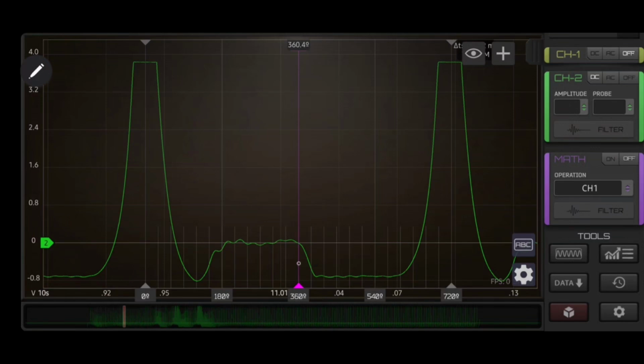Now see this right here, this is what I was talking about earlier with our top dead center mark. See how it's right here where this waveform starts to come crashing down? That's good. That's where we want that to be. And then we're somewhere around 20 degrees right here, because you want 30 degrees for a non-phased intake cam, 20 degrees for a phased intake cam. So we're about 20 degrees right there, which is just about perfect, halfway up our slope right here. And we want this complete action to happen before 45 degrees, and we're right at that mark, so we're looking good there. So then we come over, we got 30, 60.